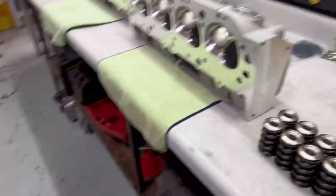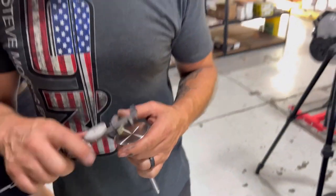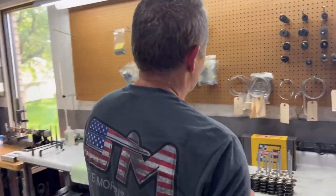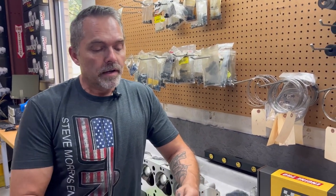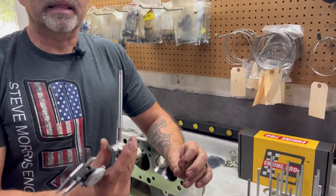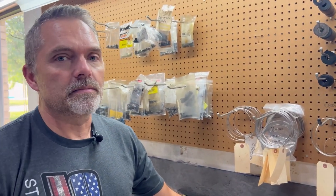Yeah, let's go measure this up real quick. Make sure you get a caliper. Had to do this because I just forgot. Yeah, this is 2400 and probably 1880 or 1900. 1880. So 1880 exhaust valve, 2400 intake valve. Now, these all come in with an 11/32 valve stem, because that makes for a lighter valve. So, as far as RPM and controlling the valve with springs, 11/32 is the way to go there, still being a durable piece. You can make even smaller stem stuff in NA, like a maximum effort NA, but it's not as durable. So that's a really good, durable, solid piece right there.